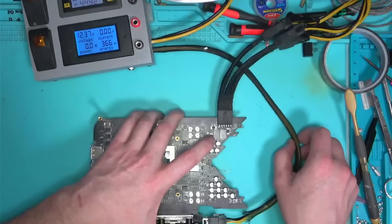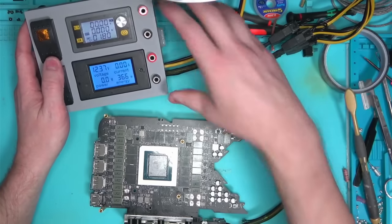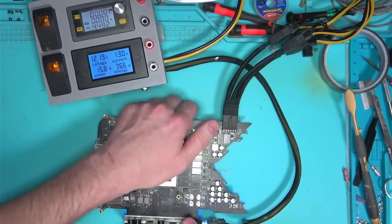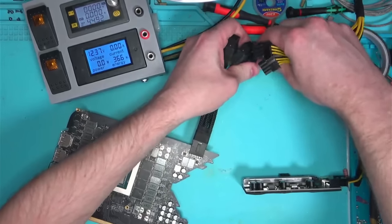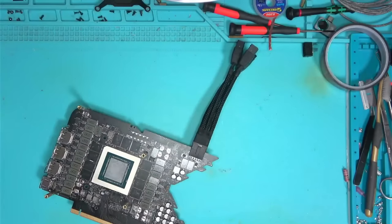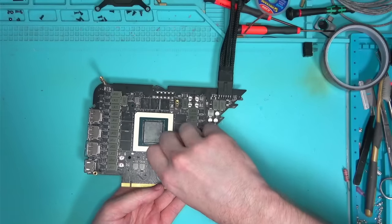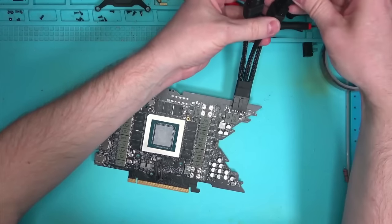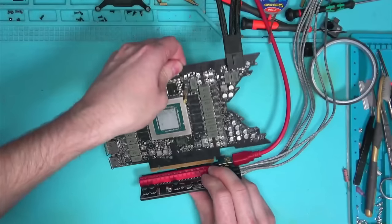Let's flip the switch and see if we get a good power draw. Looks like we're pulling 1.7 to 1.8 amps — to me that's a sign of a working GPU. But we won't know for sure until it's powered on by the motherboard. Given all the physical abuse we've seen on the surface of this GPU heat sink, it may not even post. Let me remove some of that and plug in the power supply.